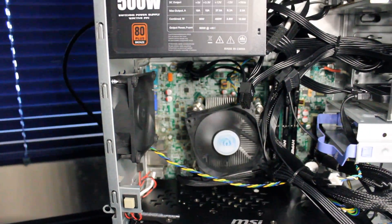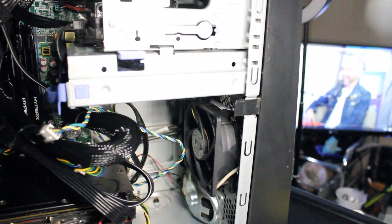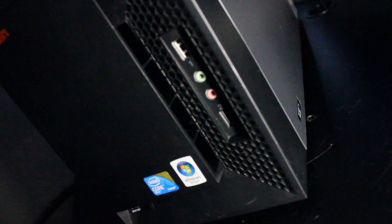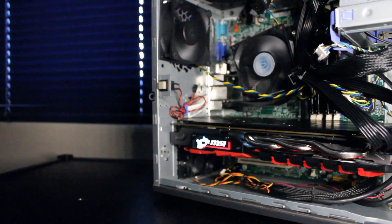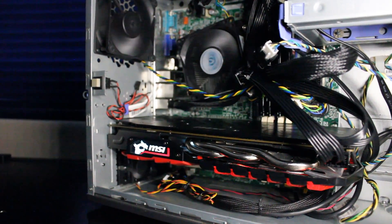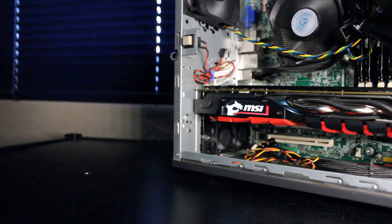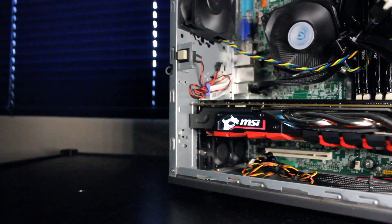The stock CPU cooler is actually still good enough. I installed one air intake fan in the front right beside the front IO — the USB 2.0, microphone, and headphone input. There is a honeycomb-style grill with some room to suck in cool air. I have one exhaust fan installed up top, and for extra cooling — because this case will get warm with this type of graphics card rated against a solid wall with no ventilation — I installed two small exhaust fans to help blow extra warm air out.